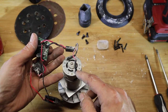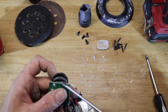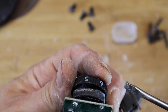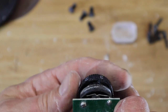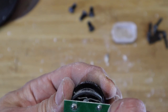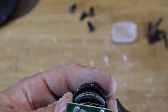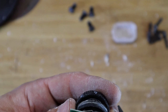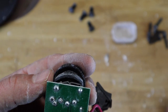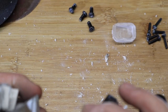There's a little capacitor and a little microcontroller. When you turn it to full max, it basically bypasses the whole switch — you can see this little mechanical lever. As you approach setting six from any variable position, a little white cam on the edge of the board drops out of the way. This bypasses the switch and gives the current a direct path from the battery all the way through to the positive of the motor — full current to the motor, stopping the switch from having to deal with all the amperage. Very simple but effective, foolproof really.